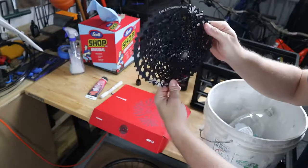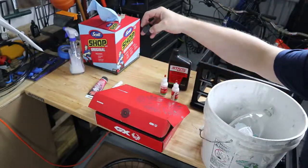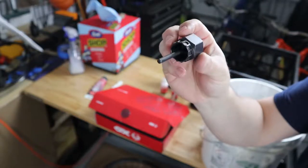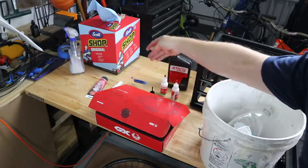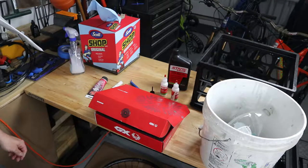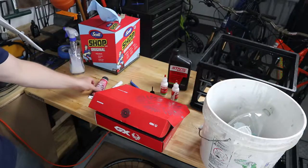Look at the size of that 50-tooth sprocket. To install the cassette you're going to need a cassette tool — it slips in and you tighten it. You might need a tire lever to help put the tire on the wheels. It just depends — some tires have tight beads, some rims have different tolerances, so depending on how much the tire and bead stretch, it may be very easy or a real pain to put on and take off.